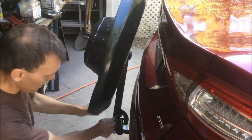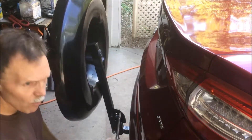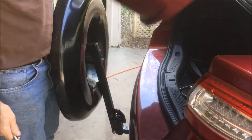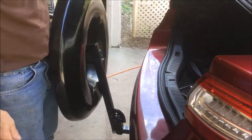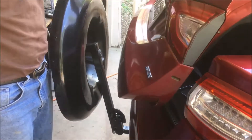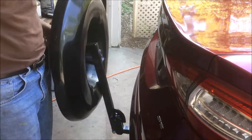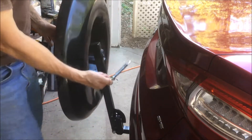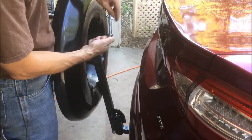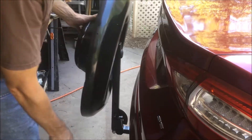As far as the way you move it, I've got a little lock mechanism that allows you to just pull the pin. Once you pull the pin, you can go ahead and unlock the trunk. It is a little bit of a challenge to get in here, but I wanted to get this thing as close as I could to the car. Within the constraints of the design, this is a pretty straightforward workaround — you just slide the pin on through, rotate it, and it stays in place. The lower bolt is also pinned in, so there's no way that's going to come out either.